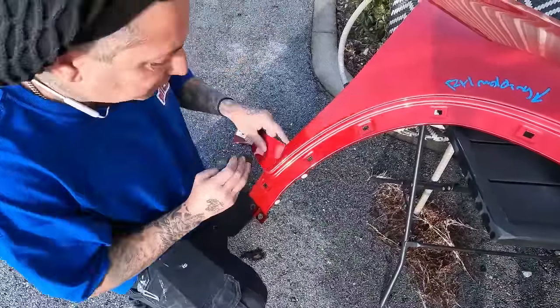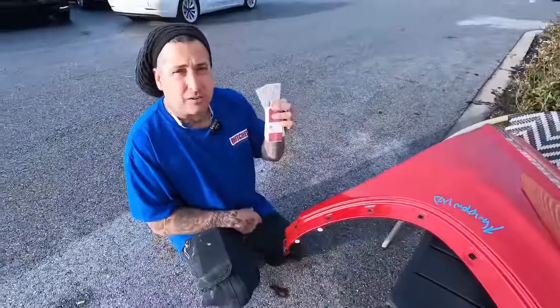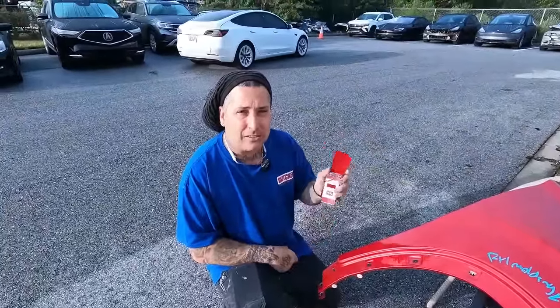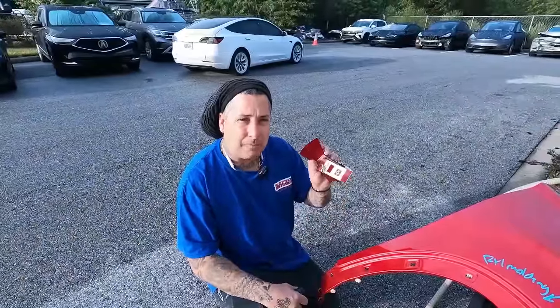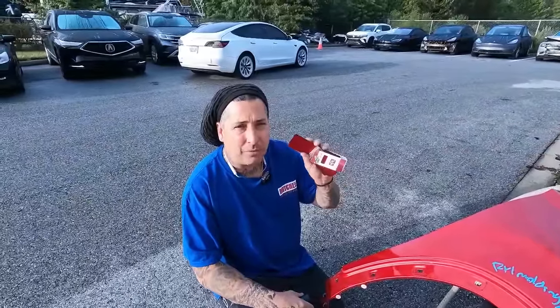We're going to have to spray it, because a lot of times you're going to want to do that to make sure that you have the right amount of coats, because on these here 3 stages, they don't tell you how many coats are on this. So you gotta kinda guess. And the best way of doing that is to spray a card. That way you can see your letdown panel, you know how many actual coats of the candy to put on this job, rather than just taking a guess and having a problem. So don't just trust the chip, always spray a card. That way we know we're not gonna have any problems later.